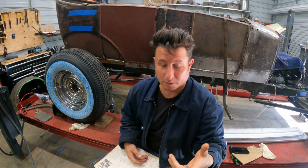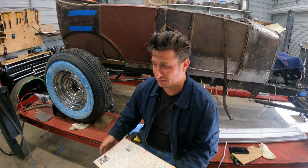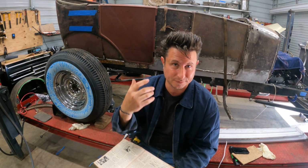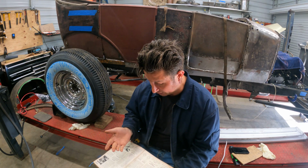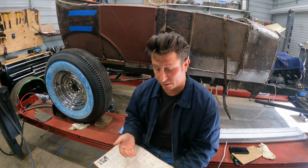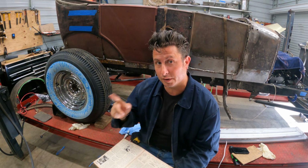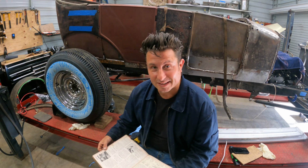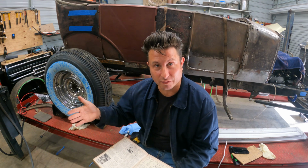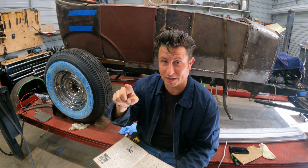Gang, I just wanted to see if there was any consistency, so I flipped over to the Cadillac section, mostly because it was close to Chevrolet, but I also like Cadillac motors. Both GM products. This is interesting because it does not give a tolerance for taper. It does give a tolerance for newly refinished cylinders, which is 7/10,000ths of an inch, 0.0007.